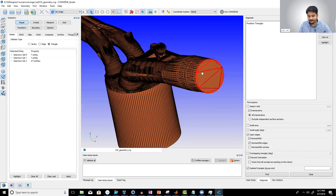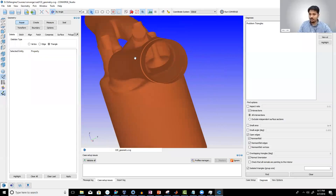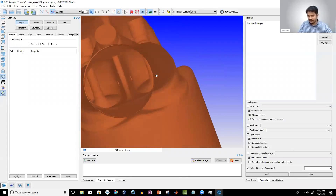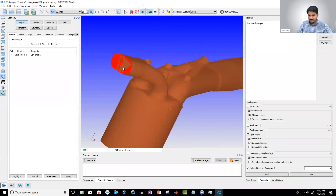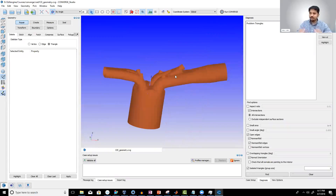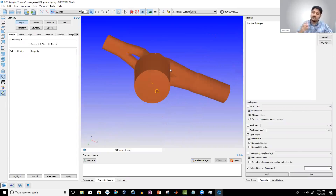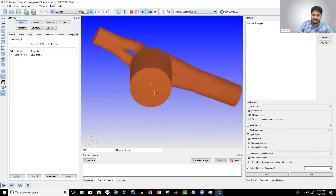This is the first thing you need to learn about simulating any engine. If you're simulating the flow inside the engine, you only need that volume — having your engine block, your tailpipe, none of those things matter; you have to delete them. If I hide a few triangles and disable the edges, you can see the flow path much more clearly. The port fuel injection works by injecting fuel at the back side of the valve, then the valve opens. This entire region is where the air-fuel mixture and burnt products interact — this is the wet volume.